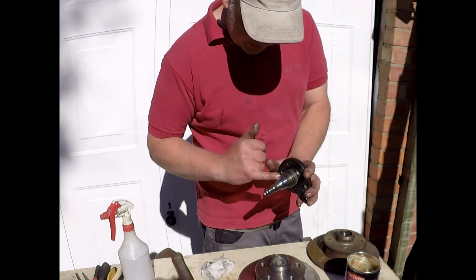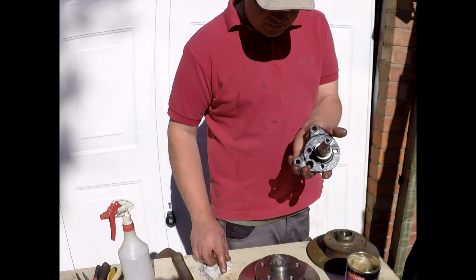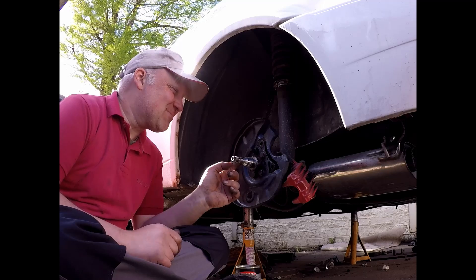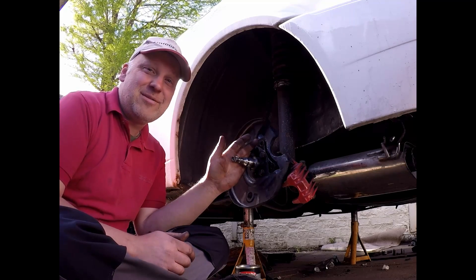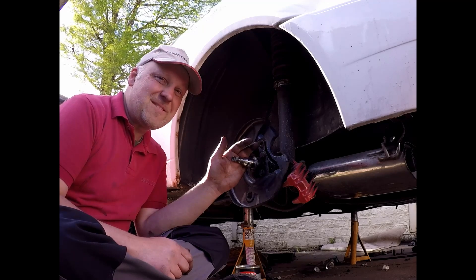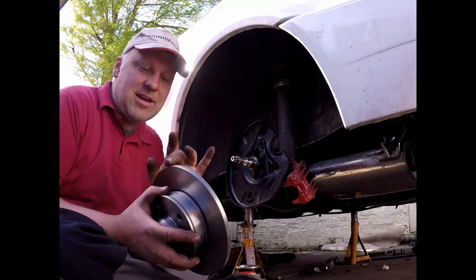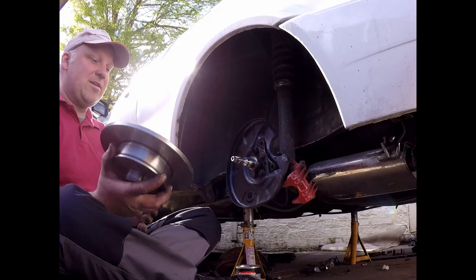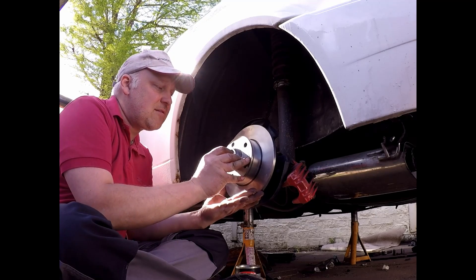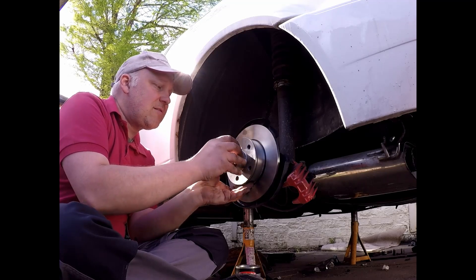If there's a little bit of grooving or marks out of tolerance, these spindles are still readily available. But if you've looked after your wheel bearings, that's not going to happen often. I've put the rear spindle back on and the ABS sensor is fitted, because I am actually fitting Mark IV ESP to this vehicle — if you're interested in that, subscribe and I'll give you a rough overview of how I've done it. I've cleaned both sides of the brake disc with brake cleaner, ready for the brakes to go back on. It simply sits over the top.